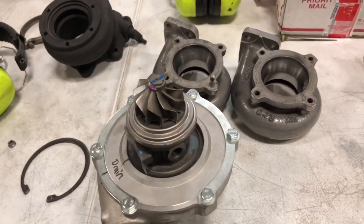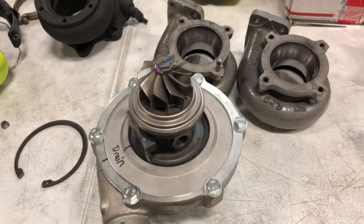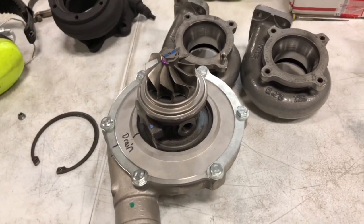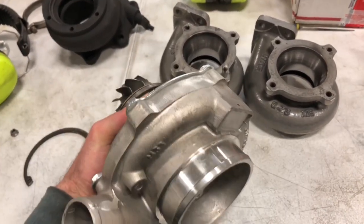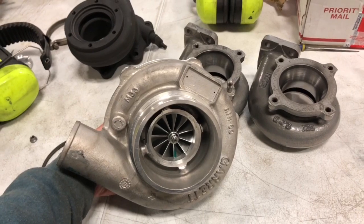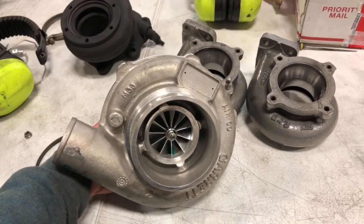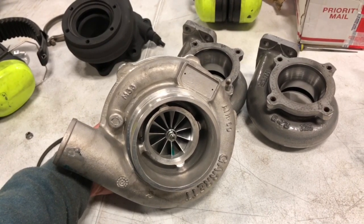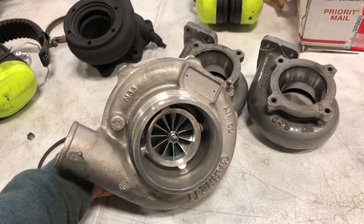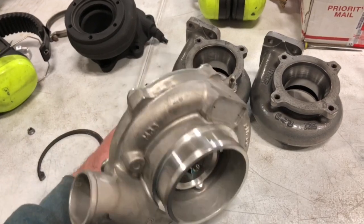On that build for those soldiers, I did the 55mm x 60 turbines on both of them, then did a GTX 3076R compressor wheel, so when I did that upgrade that made the two turbos combined good for about 1100 horsepower on the Skyline. One of the other soldiers just had me do a rebuild, and I used some parts from the other turbo — the compressor wheel and turbine — to fix his turbo, since those parts were so rare.